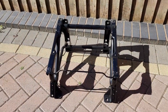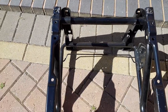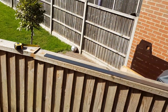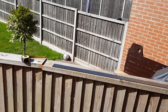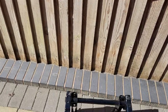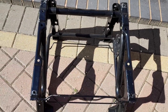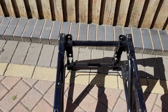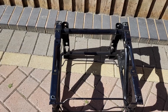So along with the captain's chairs I've also had to pick up a seat base. Now as you just saw, there were six bolts holding the original seats to the bases, but unfortunately the holes on the new captain's chairs don't align perfectly. So what I've done is I've picked up a two-metre length of steel which is six millimetres deep and 60 millimetres in width, and I'm going to cut that into four pieces, and each piece will bridge a section of the seat base. I'll bolt the steel into the seat bases and then bolt the captain's chairs into the new steel, and hopefully that will securely and safely hold them.